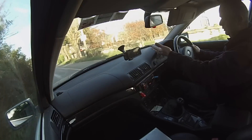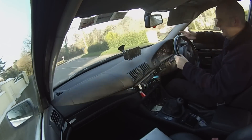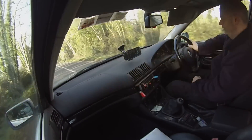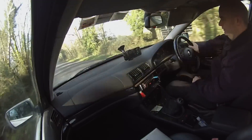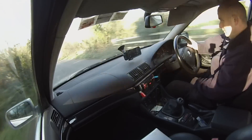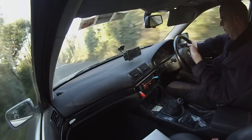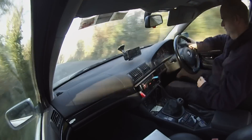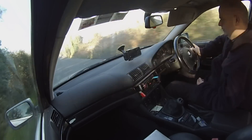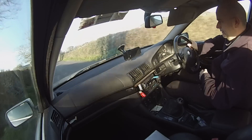Coming up a little incline I'm pulling 110 amps — quite respectable acceleration at 2,500 revs in second gear. I want to get off to speed so I push the throttle and there's my current limit again. Letting the revs build up, I've got 140 amps and I'm accelerating quite nicely. I'll stay in second gear and maintain speed against this hill. Previously with f-slip max at 3Hz it just wasn't able to maintain speed against any kind of hill, but now I can hold 40 miles per hour.